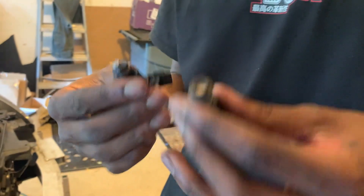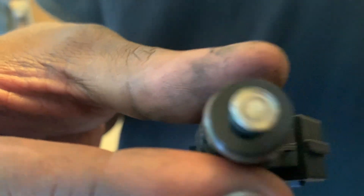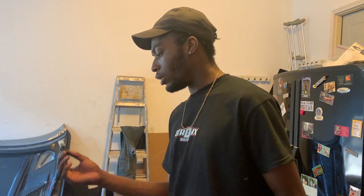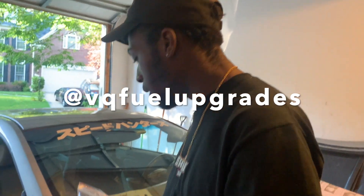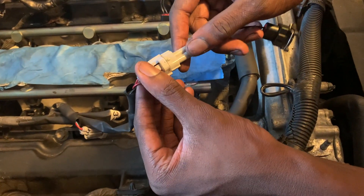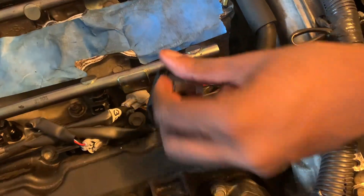Just repeat the process for the other injectors. This is the OEM and this is the Bosch — crazy difference. This one's slimmer but it's a four-squirt; this one is about eight. Hopefully the thing's gonna be good on E85 — if Walbro's here, she's good for E85. There's a pigtail adapter that comes with these since they're universal injectors — shout out VQ fuel upgrade. You just clip them up and it'll adapt right to your VQ motor.